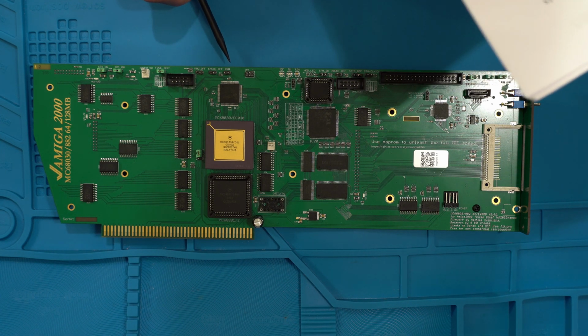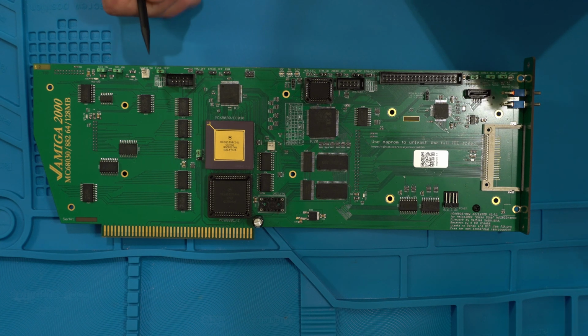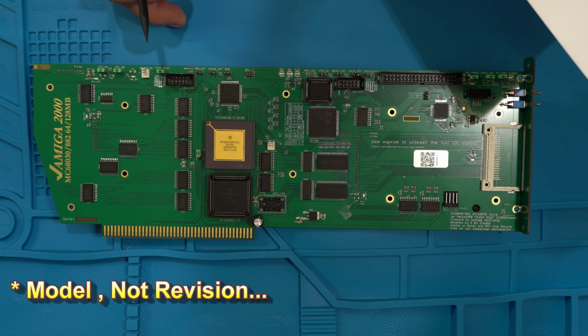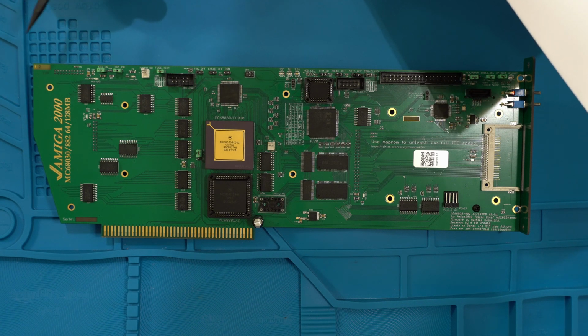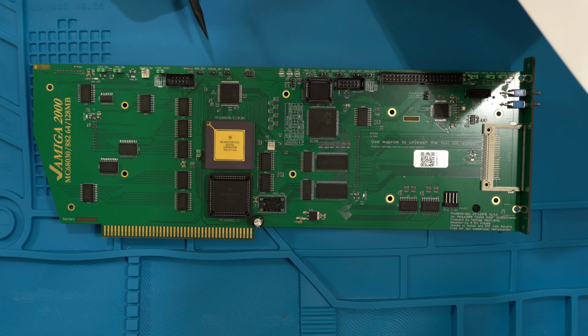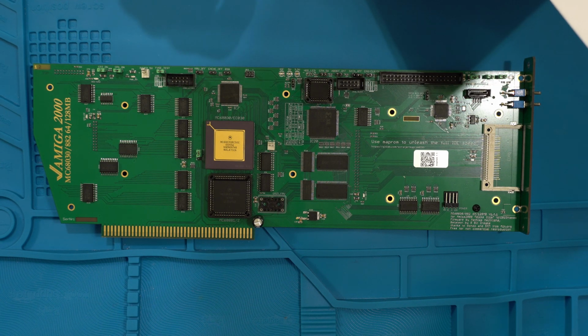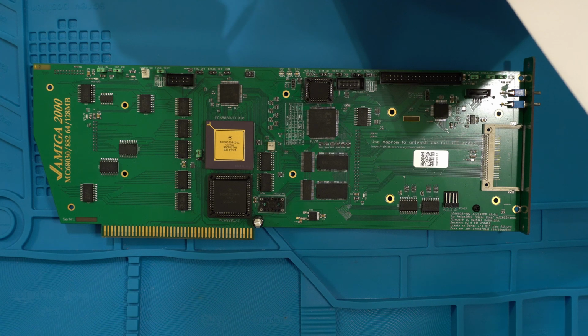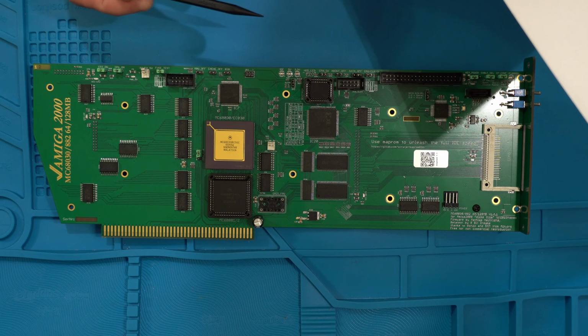And this is the BSW, which is a German name of some sorts, for the revision A of the Amiga 2000. So most Amiga 2000s are the Amiga 2000B. Apparently the A version, you need to have this enabled. So you have to have a pin here to have the accelerator card, and unlike this one, which has this, you can leave the 68000 in, you have to remove it for the early German versions of the Amiga 2000A.